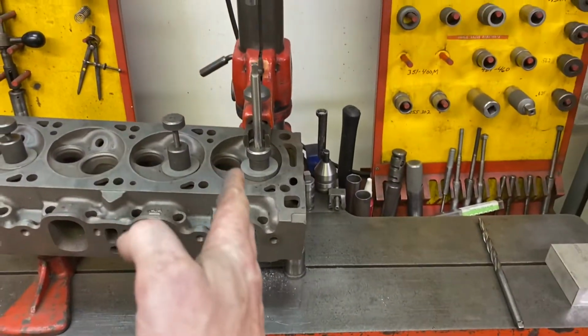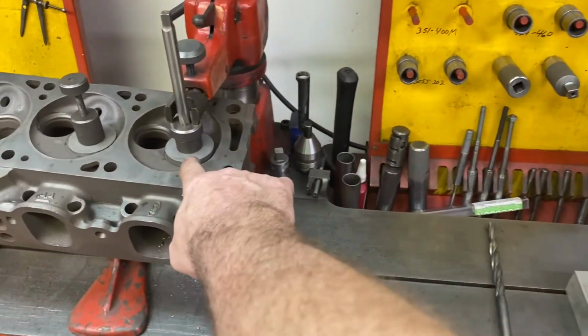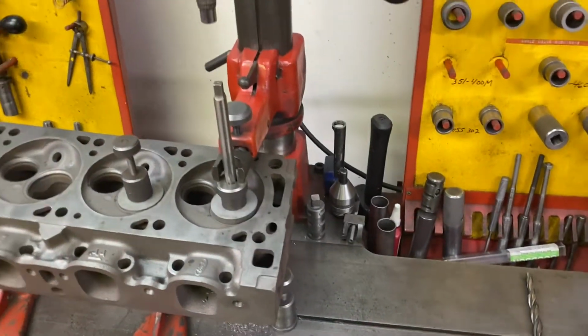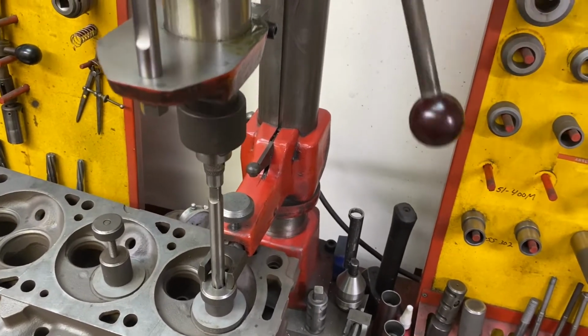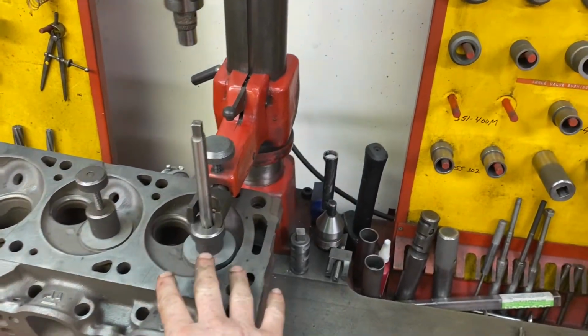So the tooling drill sleeve, or drill bushing, if you want to call it, sits on the seat adapter, and it's actually locked to the column, completely locked down. And the drive of the machine simply doesn't influence it at all. So it slips right on, and there's some slop in it. So this is where the accuracy is: the tooling.